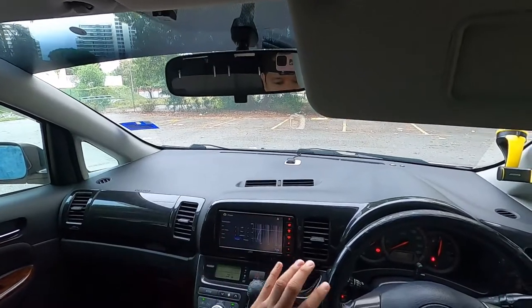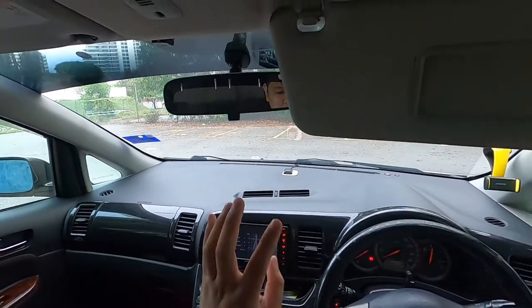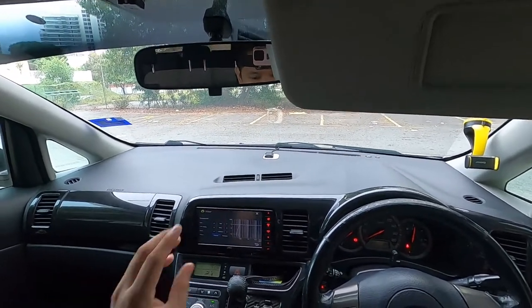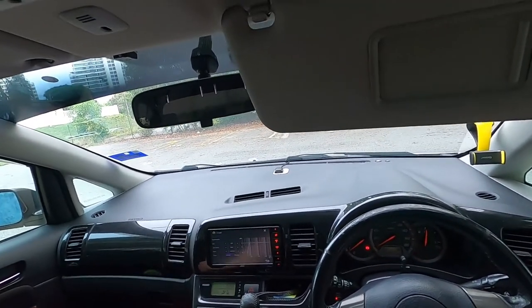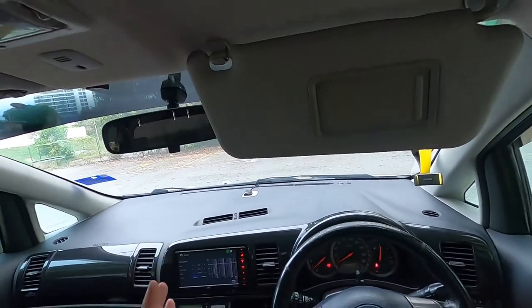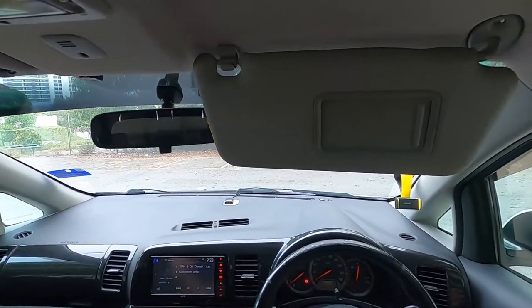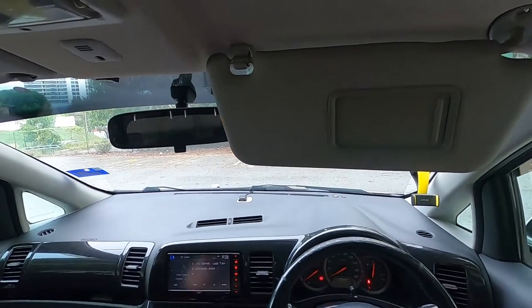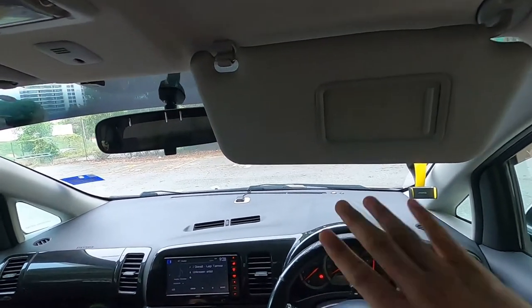And the gain of the subwoofer, I go very low, up to negative 8 dB, which you can also set at the subwoofer, which is not handy because you have to dial it down under the seat. Okay, so that is a particular setting which I think suits my car cabin very well. The bass is very smooth.